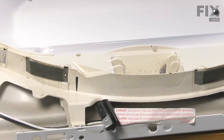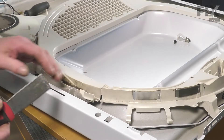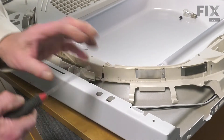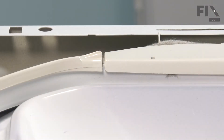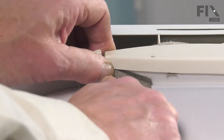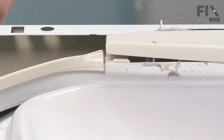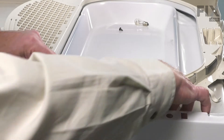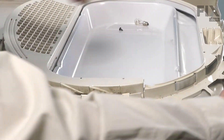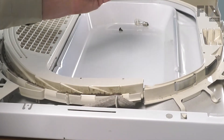Once we get around to the lower half of that housing, we'll need to lift that up enough to pull that harness out from between those two plastic pegs. To aid in separating that housing from the front panel, you may want to use a stiff putty knife. Coming through from the backside, you should be able to just pry up on that. Carefully pry on that plastic housing while supporting it from the outside at the same time — you just need to pop that up enough that it will clear those plastic pegs. Once that harness is free, just peel that out and remove it. We won't discard that just yet.